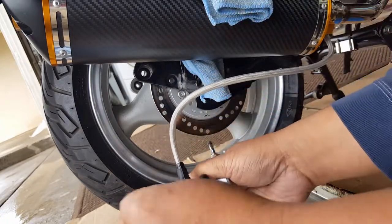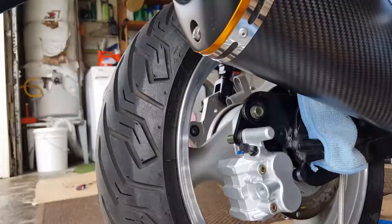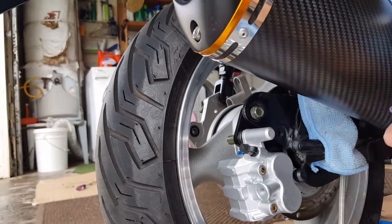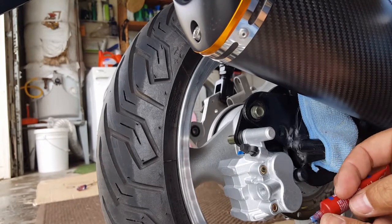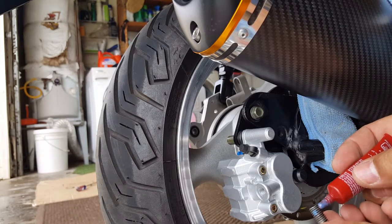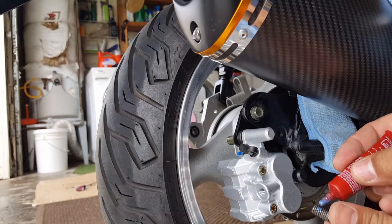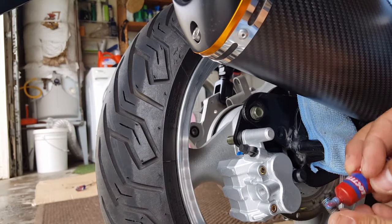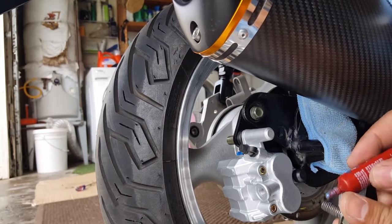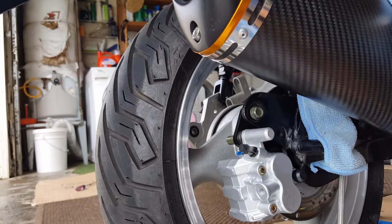How he's really gonna be. Kinda unloosen this. Get repositioned again. If you're installing a brand new brake assembly, go ahead and just put that first on there. That way you can position the hose afterward and get some blue Loctite. There's gonna be two socket ones, but I believe they're maybe M10 thread size. So I'm gonna put some blue Loctite on here. And then we're gonna go ahead and feed that in there. There we go.